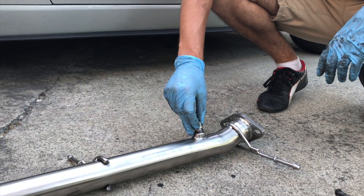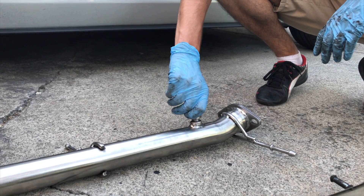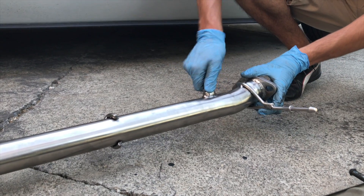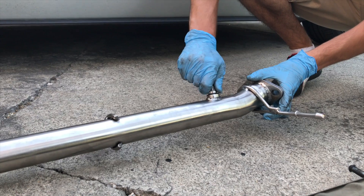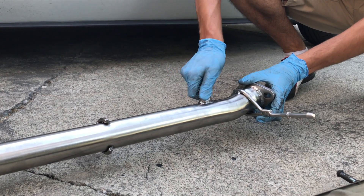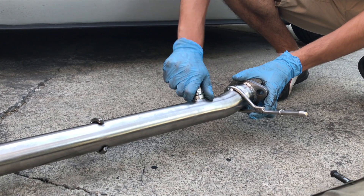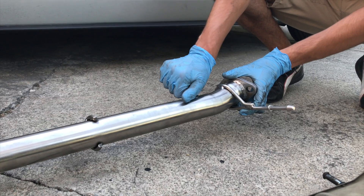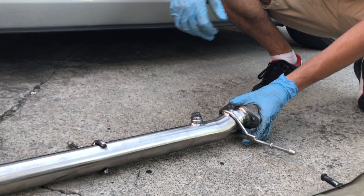And you can see in the back there is actually a hole for an O2 sensor plug. Since my car is a 1991, it doesn't have an OBD2 sensor, which means that the O2 sensor is actually in front of the cat. So in my case, I just plugged it with the included bolt. Now if you have a newer car — so if you have a 94 or newer — you are going to be plugging in your O2 sensor in there so that you don't get a check engine light coming up on your dashboard. So that's super easy.